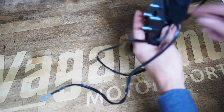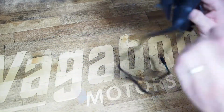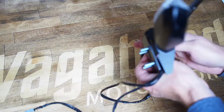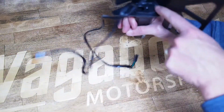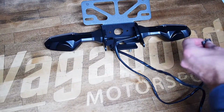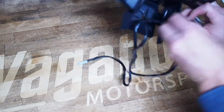And if you can't quite seat the front, I'm going to try a slightly different approach on this one, because I seem to have difficulty seating. So if you get the two tangs under the front seated, that one was kind of fighting me, but you can usually muscle it under there. As long as it's seated under all four of those little barbs, the Kawasaki turn signals are very secure. It's an interesting design, but it works rather well.